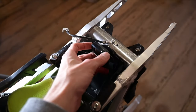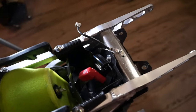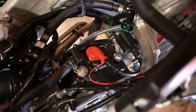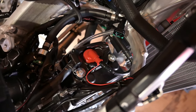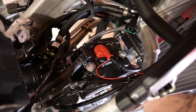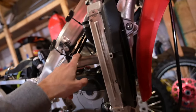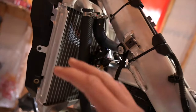The hour meter goes over here — I'm gonna hold it in place with zip ties. The battery fits in nicely, so I run the wire over here and around. Basically what needs to be done is to run the red lead around the spark plug wire, five loops — that's enough and it should work. Installing it is a little tricky because of all the zip ties and wires on the other side.